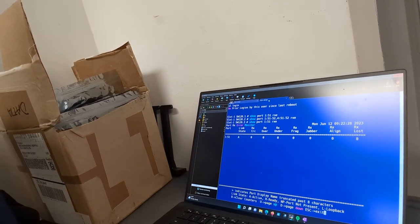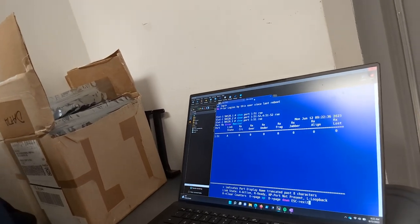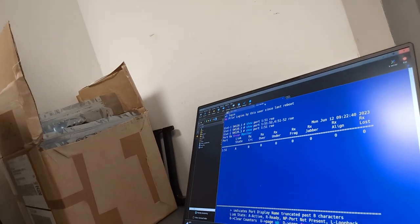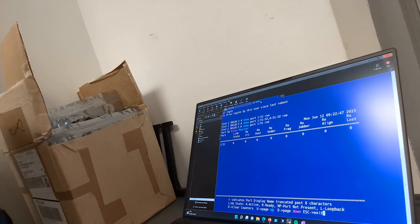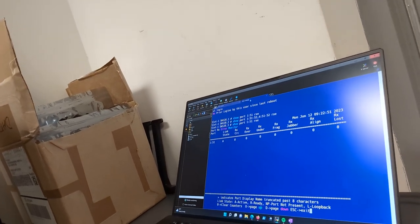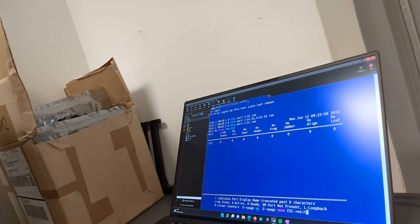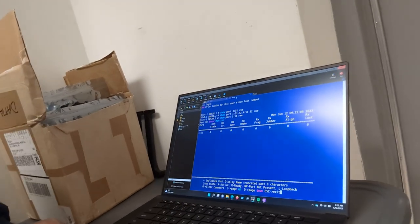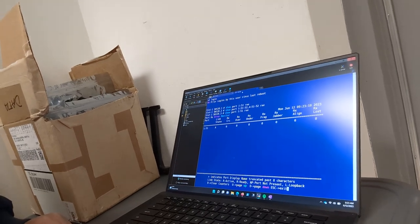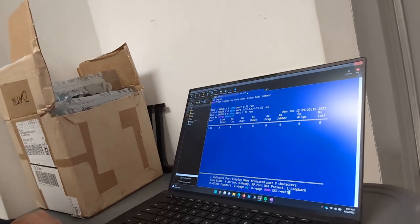It generally doesn't take too long, unless I got lucky and this end of the fiber link was the problem. That could be. One of the biggest problems I have here still are my fiber links — usually from here in the data center out to the switches out in the hospital. Some of the fiber runs are quite long. These links should be able to handle it, the GBICs I have. But still we've got quite a few where we get CRC errors and it just starts jumping around, causing the link to go down.